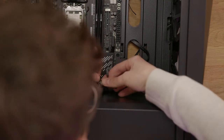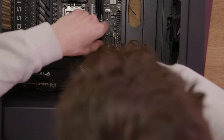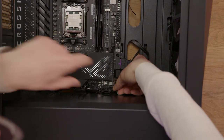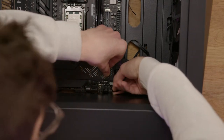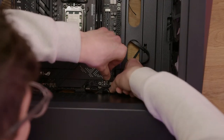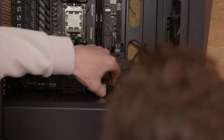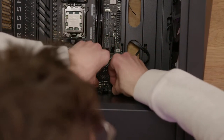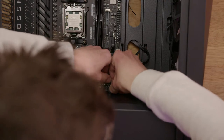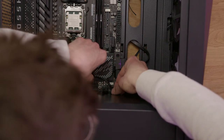He's asked, how's the water-cooled Corsair build going? I'm still using it. Thea was playing Planet Zoo on it yesterday, so it does work. It's just that when you benchmark the CPU in Cinebench, it hits about 97 degrees, so it's still not installed properly. But for gaming, it's fine. What would be the point in buying a new block to get it 20 degrees cooler when I'm never going to be maxing out the CPU? It's not worth the effort. It's a shame, but I'm sure I'll end up doing a completely new water-cooled build, and that will make more sense.